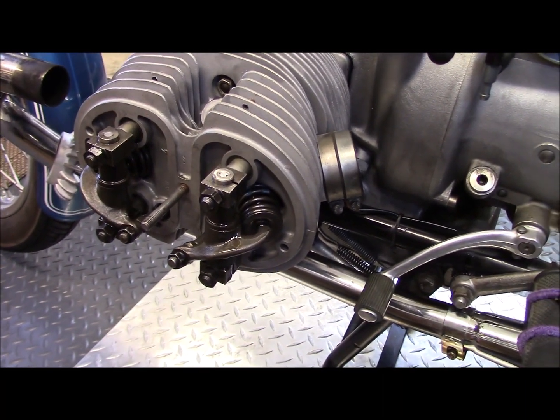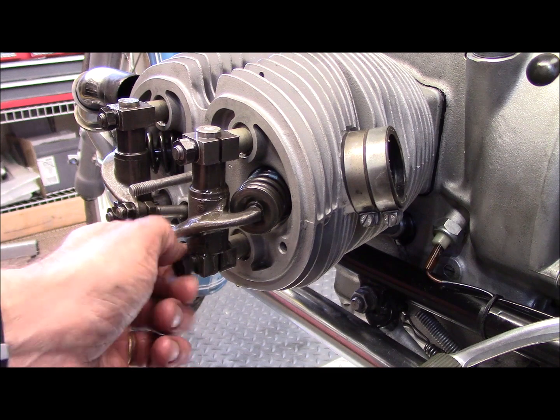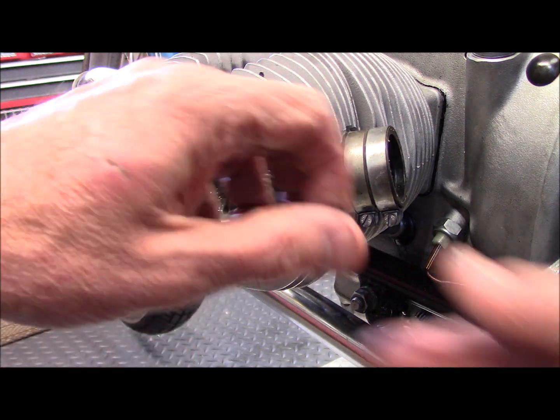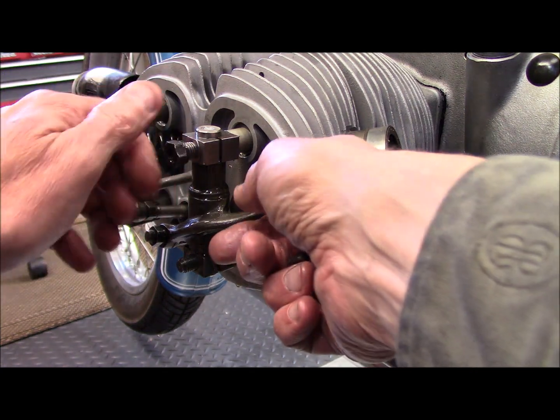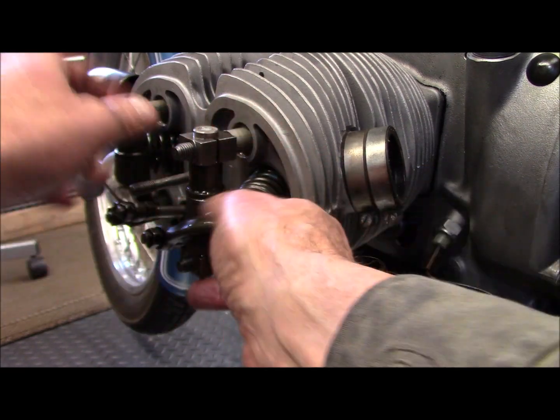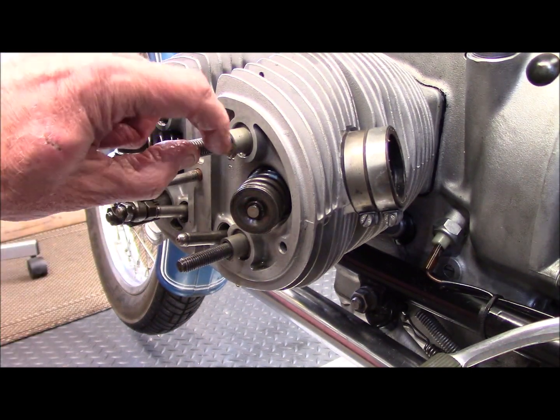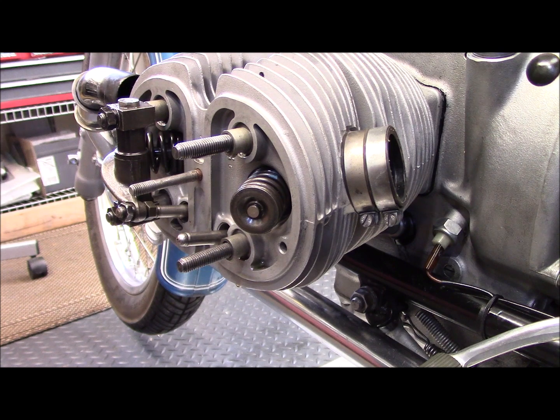So I'm about ready to run my test. To make it easy on myself, I'm just going to back these two nuts off and pull the rocker arm assembly off the engine. These still have about five to ten foot-pounds on them, so they'll hold everything but I won't damage the head because they're pretty low torque. Then what I'm looking for is oil flow out of here. It may take a while to crank the engine and get enough pressure to push the oil up this passage, so don't be worried if it takes a little bit of cranking.